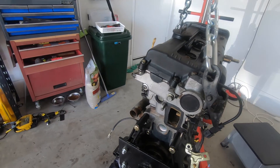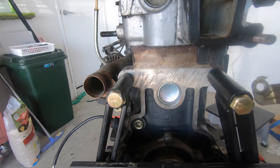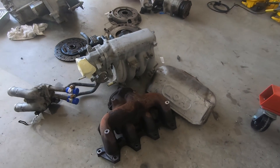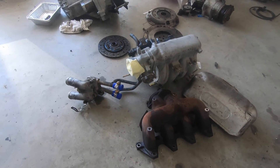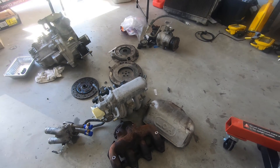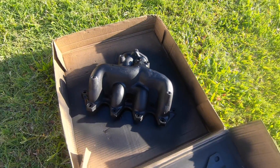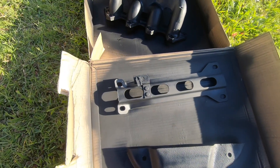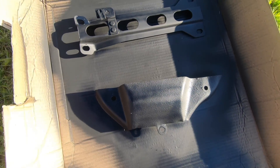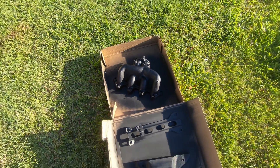It's now slowly coming together very nicely. It's the first chance I've actually got to see the engine numbers down there — G4FK, it's got the engine number on there. So it's actually coming together really nicely. I'll get started on this exhaust manifold right now, and then we've just got to replace the thermostat and a few hoses, and then we can start getting it ready to go back in the car. I've started painting the head a nice black colour just to get rid of all the rust — that's after using some rust converter. I've also painted the back brace for the intake black, so once these are painted I'll stick them in the oven to cure and then they'll be right to bolt back on, hopefully tomorrow.